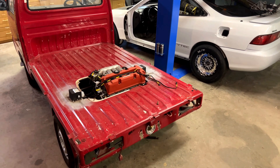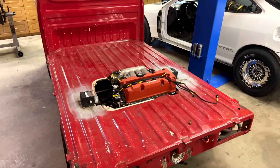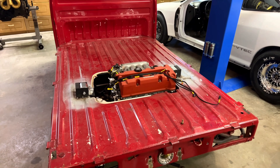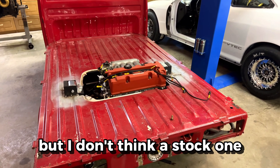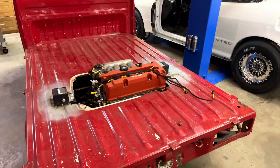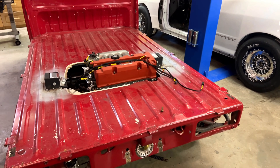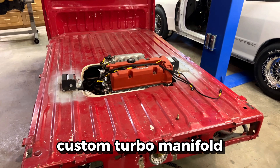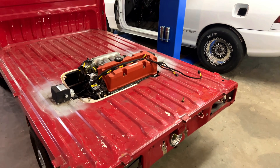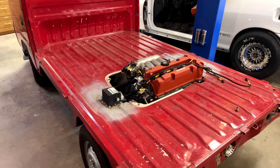One last look at the motor in the truck before I have to pull it out again. A couple of things to note if you're planning on tackling this swap: I don't really think it matters what style header or turbo manifold you try to put in this little truck. I hope someone can prove me wrong, but I don't think a stock or manufactured one exists that's going to fit in these tight spaces. Something you're going to have to consider when doing this swap is that you're going to have to make a custom turbo manifold or custom header. It's just that tight — there's a support bar that runs all the way across the back of this truck and the motor is very close to it.